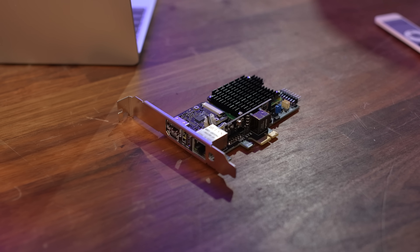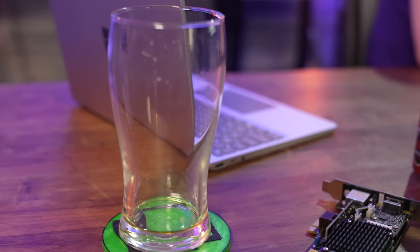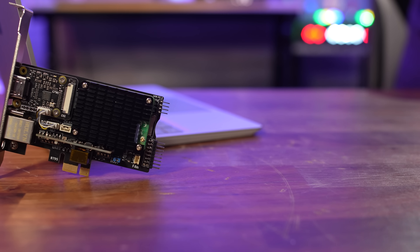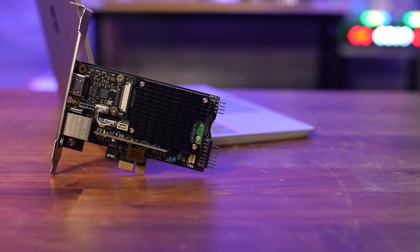So, short of just upgrading a server, or paying out the nose for licensing software for hardware that you already own, what's a systems administrator to do? This is the Bly KVM PCIE, a product from BlyCube that puts a computer into your computer so you can do your computing from a different computer. In all seriousness, we're looking at a PCI Express add-in card that aims to replace KVM functionality of IPMI, giving you the same bare-metal access to a PC, but in a modular, standalone system.